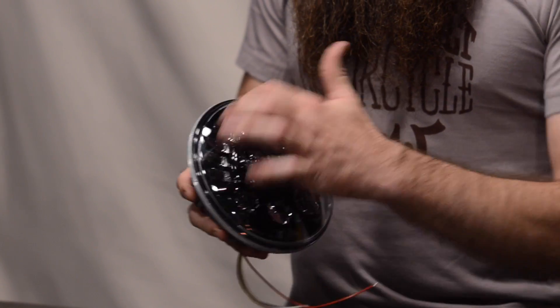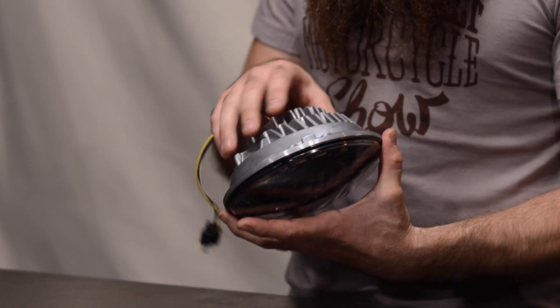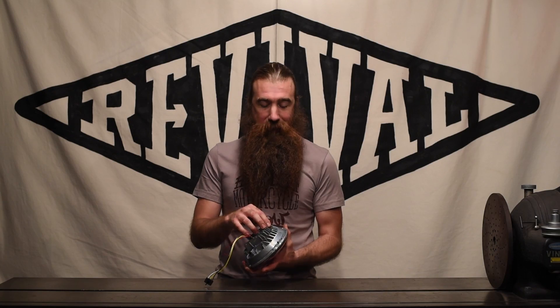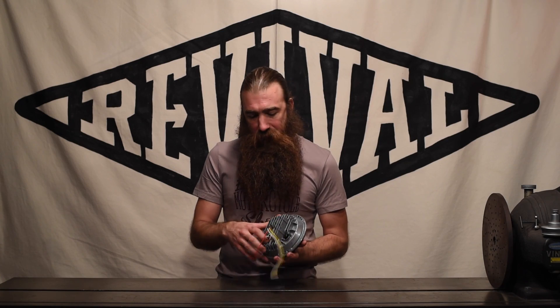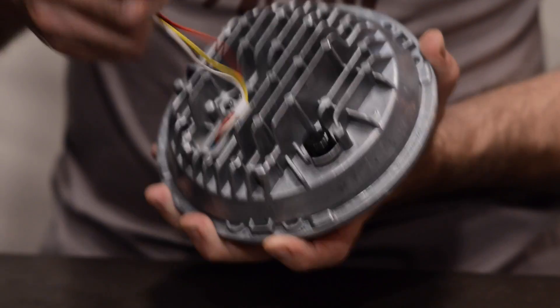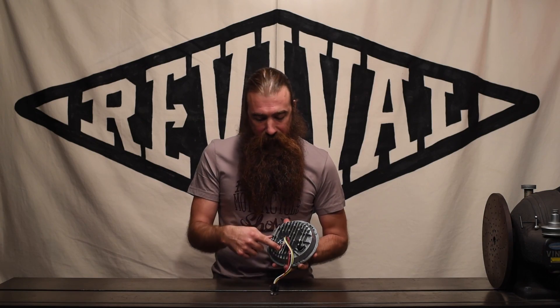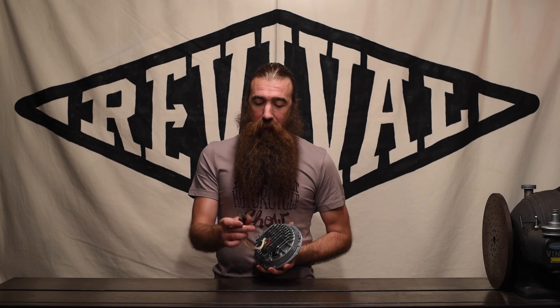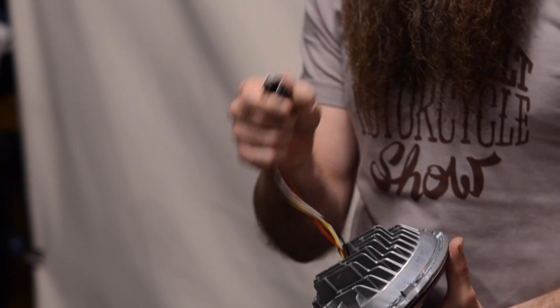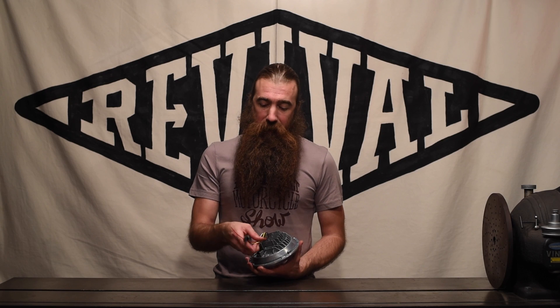So, build quality. First up, JW Speaker makes some pretty nice things, and this is no substitute. Really nice front glass element, really nice cast aluminum back housing. This is still basically in a raw finish — they didn't even bother to paint it because they didn't have anything to hide. Even the cable exits come out through a proper strain relief so that no matter how much this vibrates and bounces around, you're not going to fatigue the actual solder joints where it enters the circuit board. Also, if anything ever happens to the terminals where you plug in your standard H4 connector, you'd be able to clip it off and install a new one rather than having to replace the entire light.